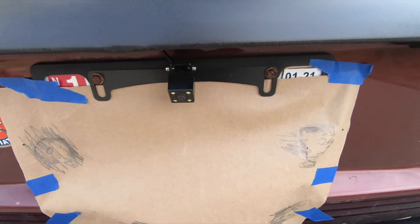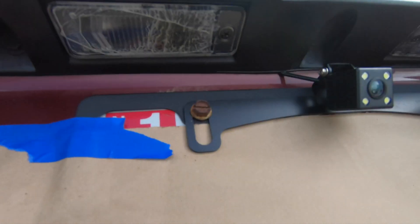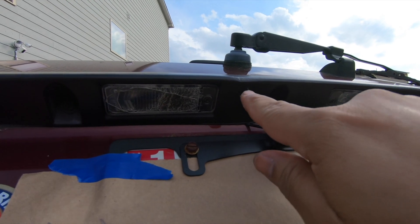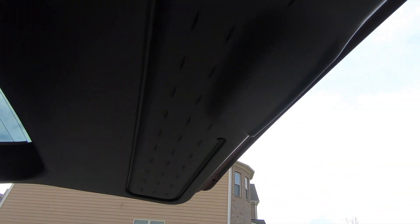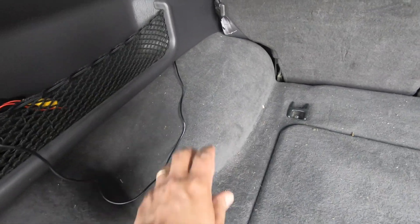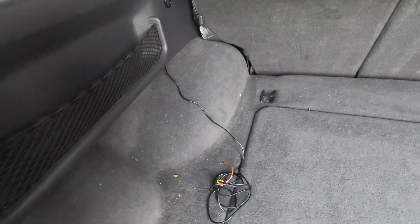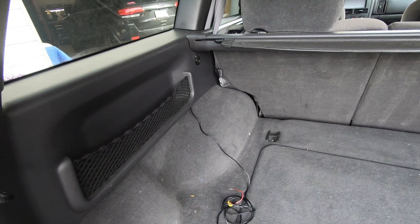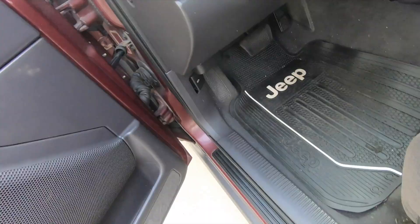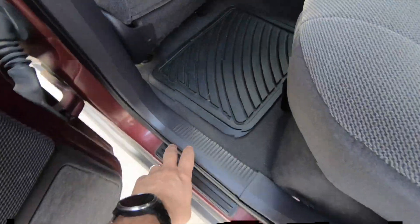What I did maybe a year ago was install this backup camera by just putting it on the license plate like this and running the cable up through the tag light housing into the underside of the back panel here. The cable is somewhere coiled up in here. From the head unit I ran this video cable with a red trigger on it up under the panel all the way through the driver side on the front and rear, and up into this panel in the back here. You can't see the cable but it's up under this panel here and it goes up under here all the way through the back.